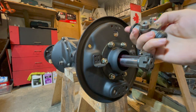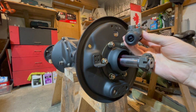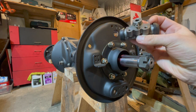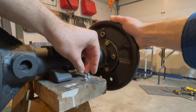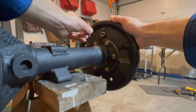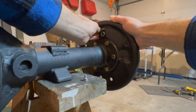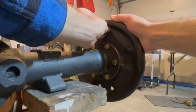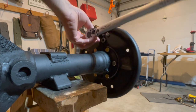The first step is to install the three-quarter inch rear wheel cylinder through the four holes on your brake backing plate. Align the holes at the top and push it right in. The next step is to install the two quarter inch bolts on the back side of the brake backing plate, threading them into the wheel cylinder. Torque the two wheel cylinder bolts to 10 foot pounds.